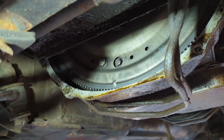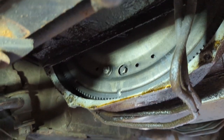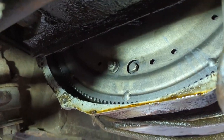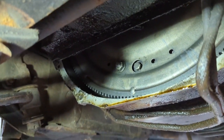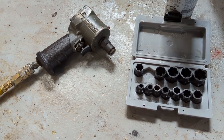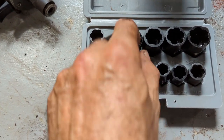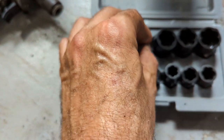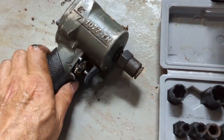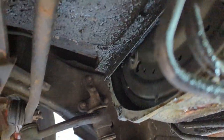I've got that cover off — it's looking good in there, good and dry inside. I'll get a socket for the front of the crankshaft and start taking these torque converter nuts off. The very first torque nut was on so hard it rounded off a little bit, so I ended up dragging out my extractors. If you don't have a set of these type of extractors, I highly recommend getting them — these have saved me so many times. Put on the impact and boom, off she comes.